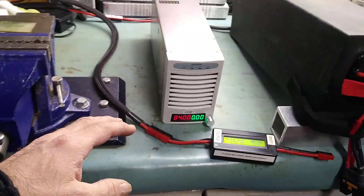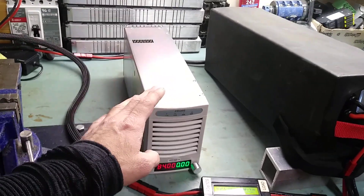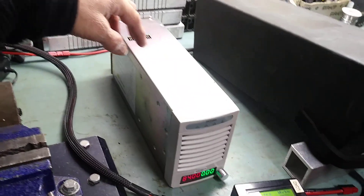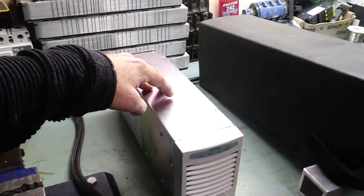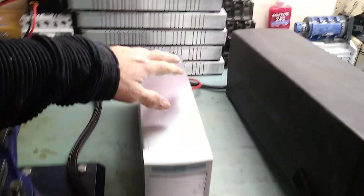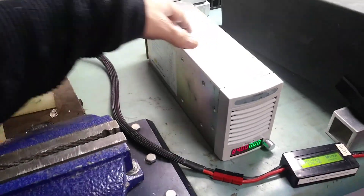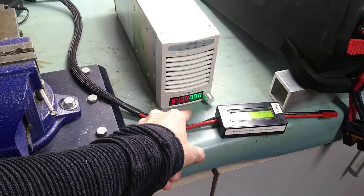It is adjustable, so it can go from 0 to 125 volts, 0 to 30 amps — that's quite a lot of current. It can work from 100 to 240 VAC, so it will work on both 120 and 240 volt AC. There's a switching power supply technology inside and also a power factor corrector, so it's very efficient and won't always trip the breaker depending on the power you use.